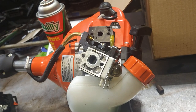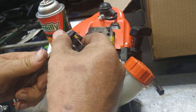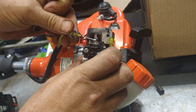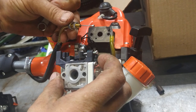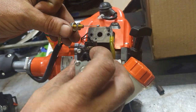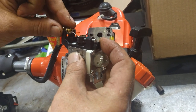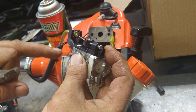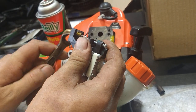We're gonna break this nut right here free - like that - and it just pops out, cable comes right on out. Close the slot, get the new one up, get the slot lined up to where you can put the cable through it. Feed the cable in until it's tight. Come back over, back down in place, tighten this thing back down. Make sure this curve goes down - tighten it in like so.